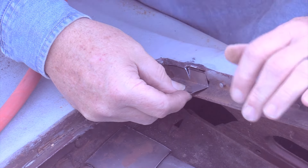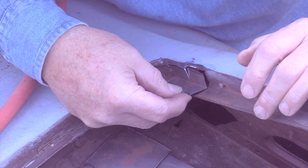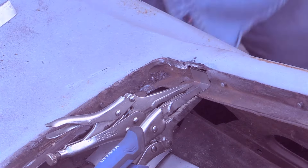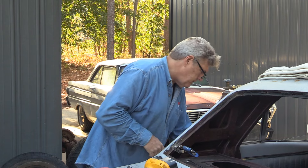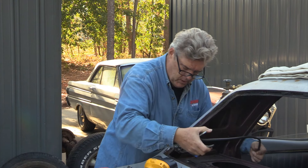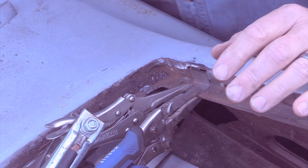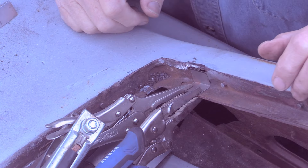We've got lead all the way up in here — I think that's going to present a bit of a problem. We're probably going to have to hit that with some sealer, but I need to go and flatten this stuff out off camera. I've got two small locking pliers in place. I throw my ground in from the back so it's not right in my way when I'm welding. I've cleaned it up as best I can — this is rusty metal, and it's just hard to get it really clean enough, because your problem is mostly on the back side of the metal when welding.